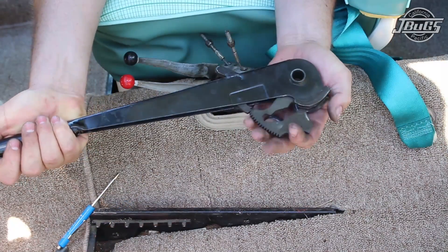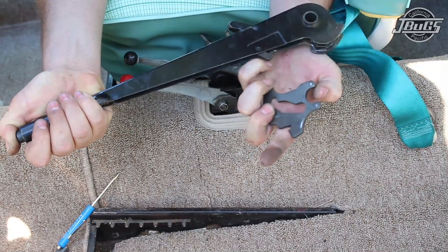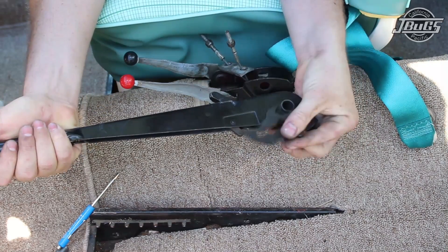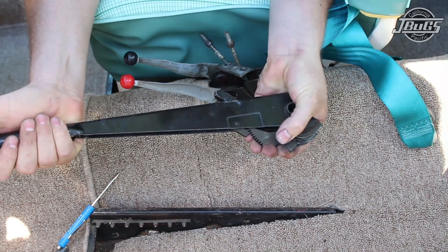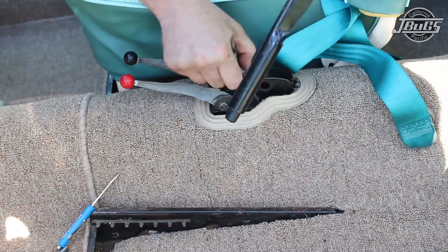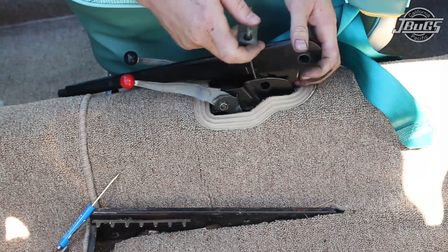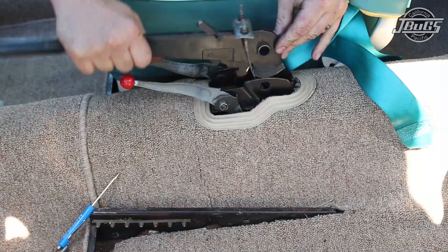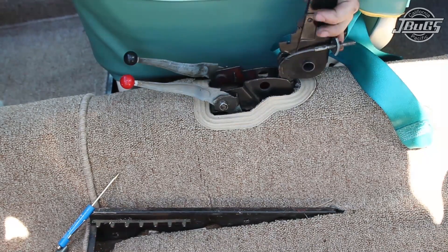With the cat's paw in place, we can slide the ratcheting mechanism in place. You'll see it's got a large circular notch on the back side which keys in inside here. Then we can slide the handle back between the cables and engage the cables in either ramp on the back hand side.